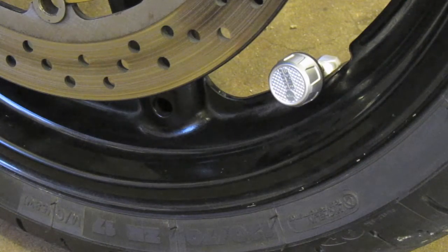One complication is that my Bandit has right-angle tire valves, so I had to be sure that the installation would clear the brake rotor. You should measure and compare against the dimensions of the product before you order it. And even then, neutral-walking the bike before taking it around the block is a good way to test things out.